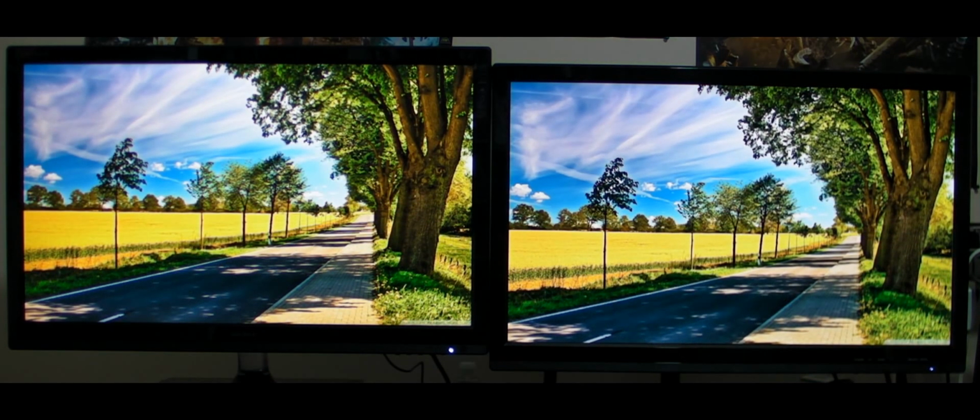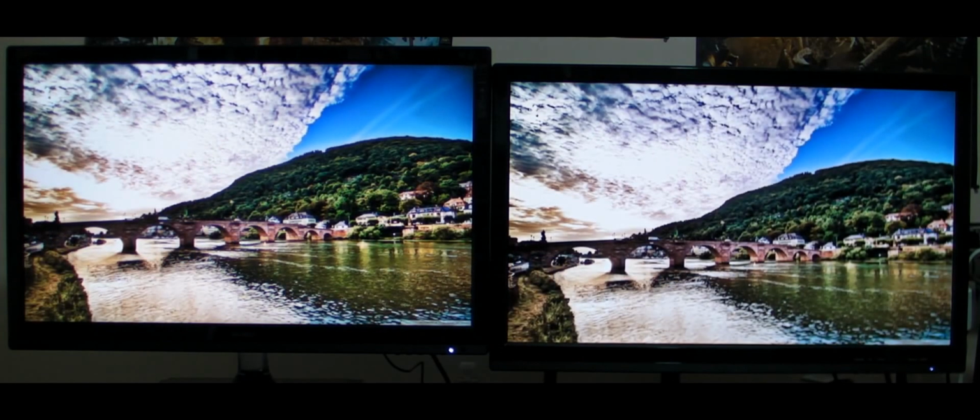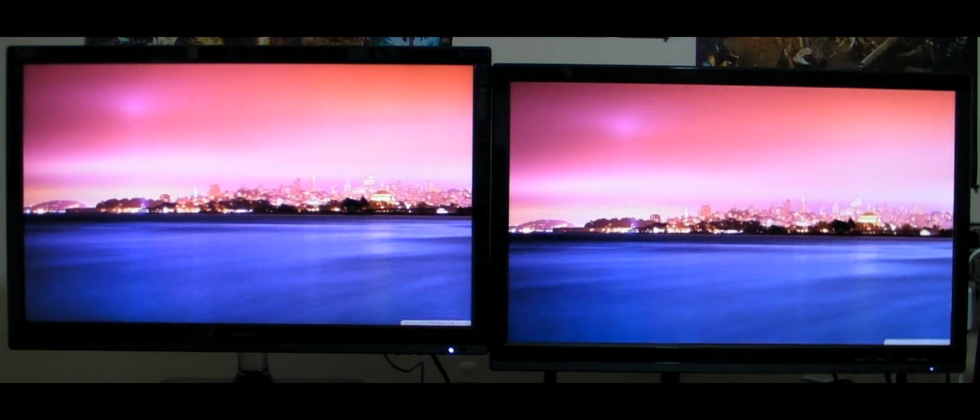However, once the display is overclocked, the gamma rises, resulting in the darkening and dulling of colors, as well as some black crush, which is why ICC profiles for the higher hertz settings are necessary, because they fix the gamma and make everything look nice and natural again. And remember, my ICC profiles are available within my written review, which is linked in the video description.